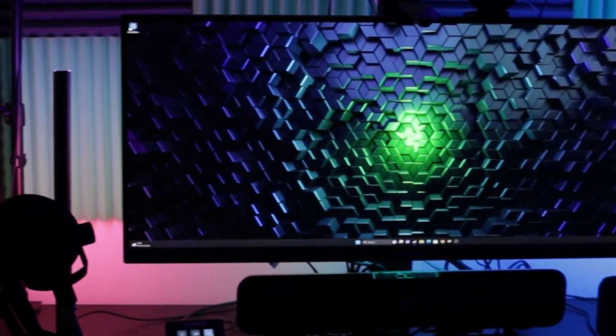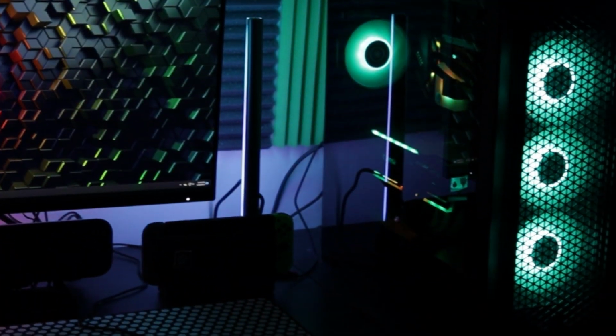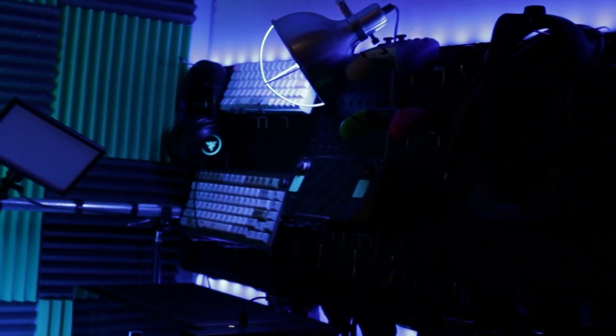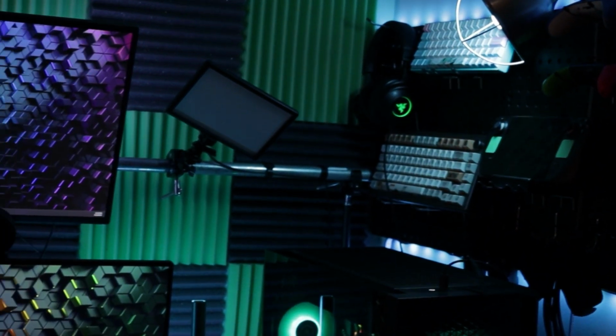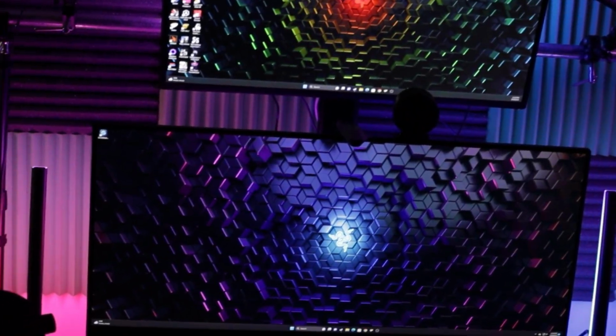But it only is worse when you look at how the motherboard's RGB implementations don't actually show up very well on the fans. I have a system that I have completely decked out to be one piece of RGB software, and that works with the EK Vardars. But if I kick over motherboard control and use the same Razer green that is currently being displayed right now on that case, it will not accept that signal, and for some reason it turns white. So it could be a bug in the system. It could eventually be fixed, but for right now, it doesn't seem that motherboard control is really that great.